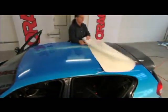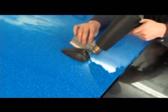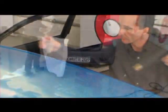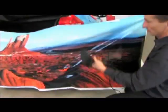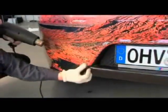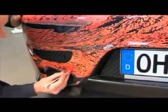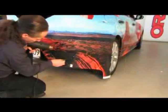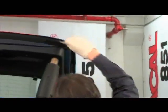The procedures to apply the vinyl to the car roof are identical with those for the hood. It's of special importance to treat the cut edges with very hot air. The approach to vinyl application to the rear spoiler is the same as for the front spoiler. Preheating of the vinyl in broad brushes and its even smoothing out from the middle outwards with the squeegee are again the most important operations. Edges always need to be well heated and pressed on firmly. The remaining vinyl is gradually applied with the hot air gun and squeegee used alternately. Please ensure that all cut edges and vinyl ends have been folded to the inside.